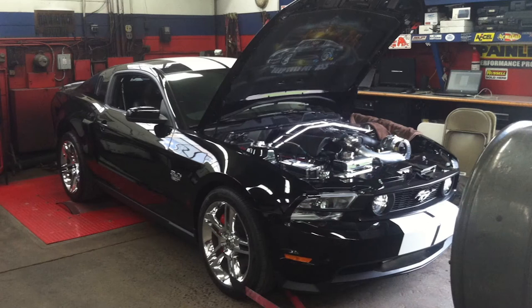As you look at different dynos, you can look at the types of loads they apply and how they do it. When you enter the test setup screens, the higher-end dynos will usually use a setup that tells the dyno the actual car that's on it. The load applied is not a flat percentage of the dyno's load capabilities and not a simple linear function. Normally, load looks more like a J-curve — it goes up more rapidly as vehicle speed increases because of wind resistance.